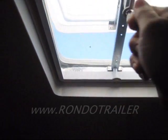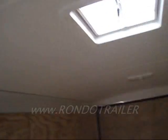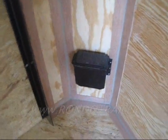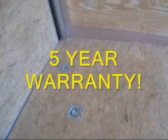Now we're going to look at the roof vent — just a simple crank up, crank down. You've got 12-volt interior dome lights with a switch right there by the man door. This is your battery for your electric brakes — the emergency breakaway battery. Here are your two gas doors. The floor is three-quarter inch Advantech flooring with a five-year warranty.